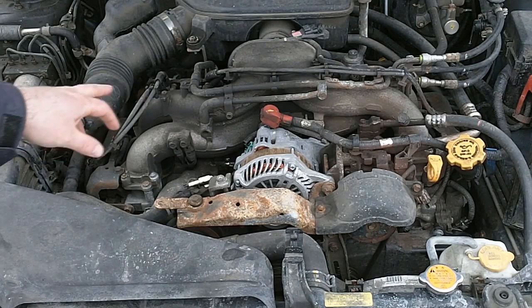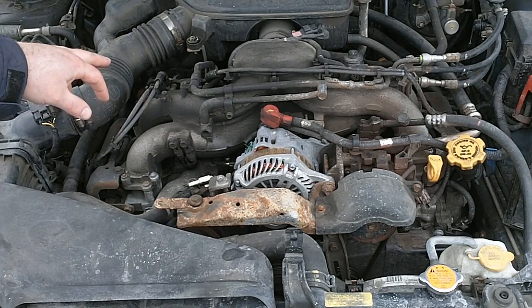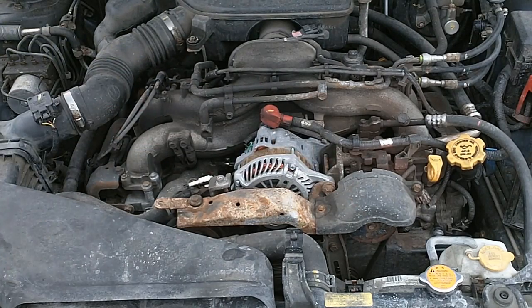And from in the area of the coil pack, I can hear a constant snapping, which I'm pretty sure is the arcing of a spark that's supposed to be going down a spark plug wire. So I may in fact have a cracked or faulty coil pack. So that's good to know. Coil pack's right down in here. I'm not going to stick my fingers on it while it's arcing heavy duty spark like that. But clearly that's not smooth like it should be.